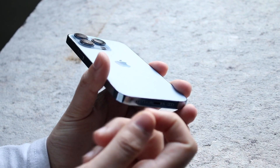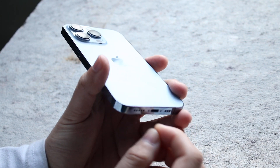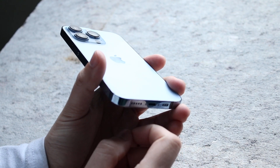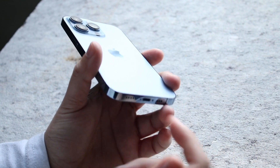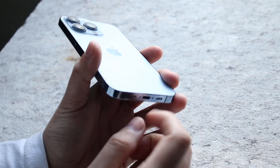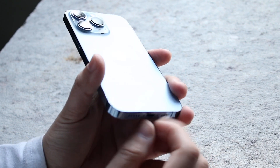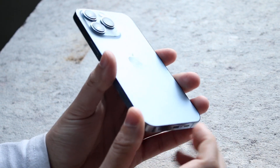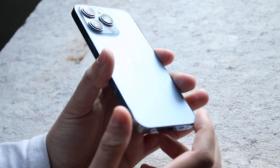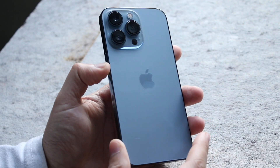What you can do is get a small toothpick or a floss pick and try prying out debris from inside the charging port. Take that sharp edge — make sure it's non-metallic — and very gently scrape the inside of the port to remove anything stuck inside. I've had that issue myself and that's really all you may have to do.